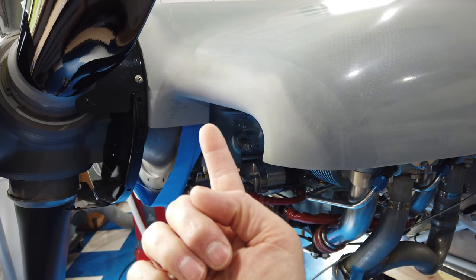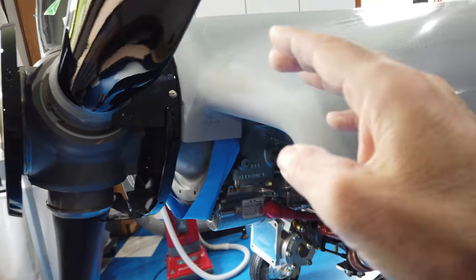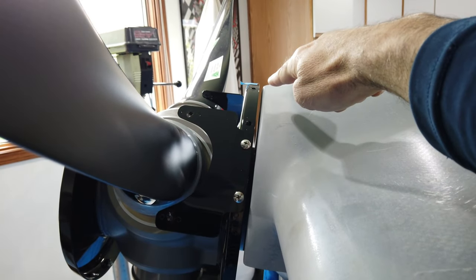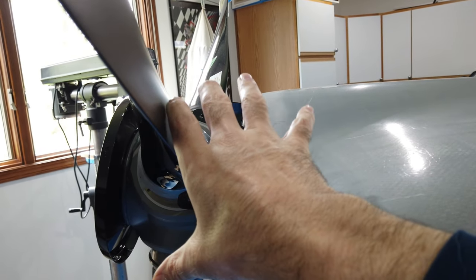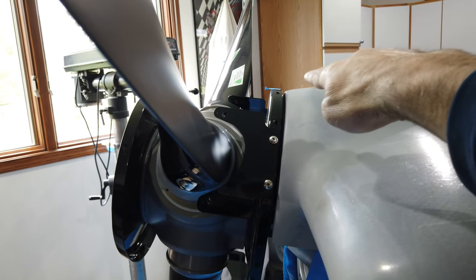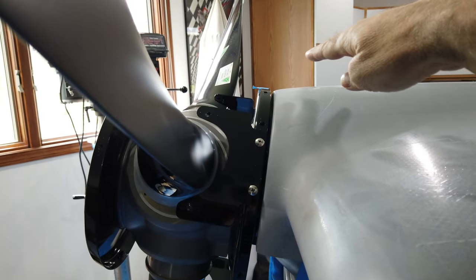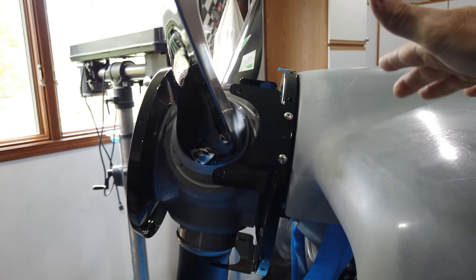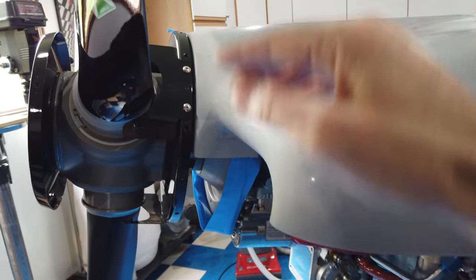I have a spacer up underneath here — basically just some cardboard and rags taped to the starter ring. That spacer sets the height at the nose. The instructions recommend having the front of the cowling below the spinner about an eighth of an inch or more. That allows for over time, as the engine mounts start to droop, the nose will come down and you won't have as big a step. If you line it up perfectly now, as the engine mounts allow the engine to sag, you're going to end up with a gap.